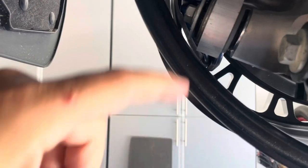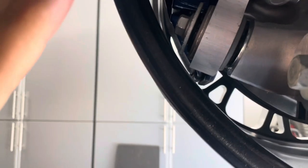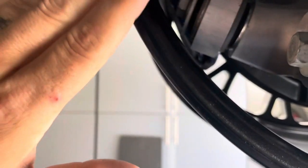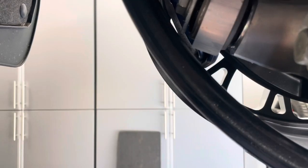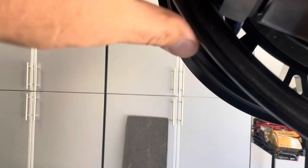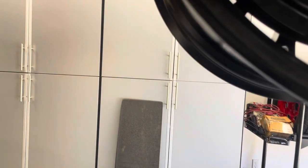The 18 clears without buying vertical links. On the GT500s and stuff, we normally have to buy a vertical link to get it to fit — we do the Cortex links or the SPE — but it doesn't appear we're going to need a vertical link. You're still definitely getting tight in there, but they do clear no problem on the 18-inch wheel.